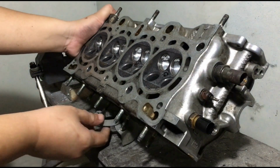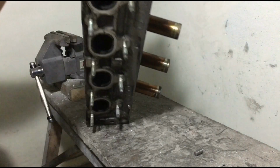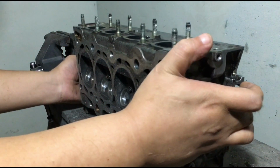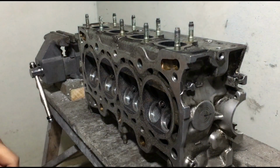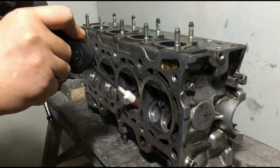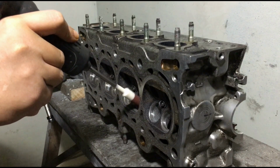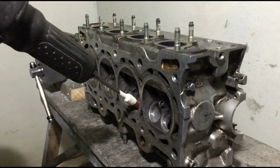Now we actually flip the head so that I can work on massaging the short turn. It's kind of hard to put it into words, but as the link that we've provided earlier, on that porting video, I drew exactly what you can or cannot do on the short turn. Just have to massage it. And for those of you who missed out on that link, don't worry. Another link will be in the description. We gotta speed this up again because my hand is getting tired.